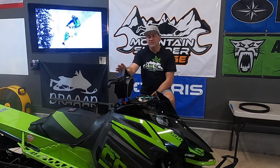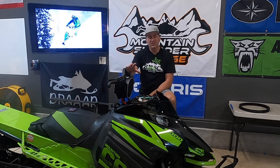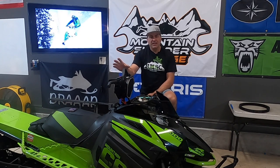Some other things to think about if you're having problems with cooling: has your engine been apart lately? Have you had the head off or something else, where you had to drain the cooling system and then put it back in? A lot of times you can get air bubbles in the cooling system, and that also can be problematic. If you don't get all the air bubbles out, then you're going to have air in there, and the air is going to act differently than the coolant for cooling. You're going to have cooling problems if you have air bubbles in your cooling system.